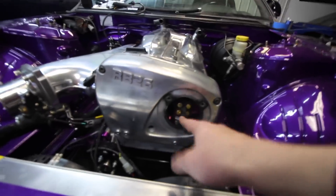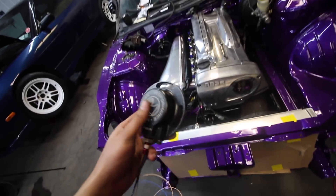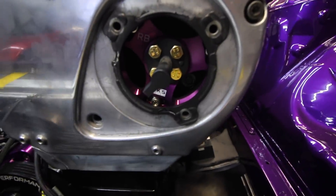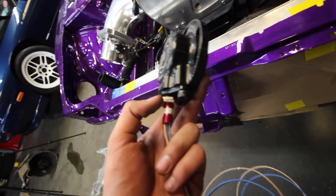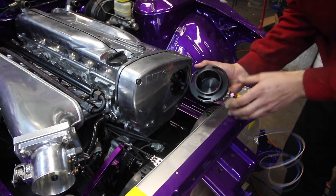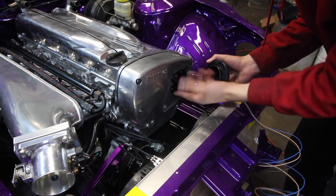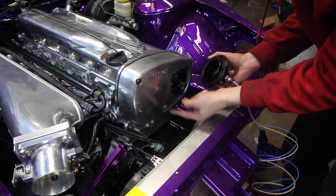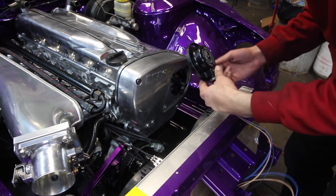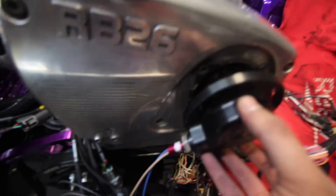I'm basically working on this right now — a very expensive piece of kit: the Ross Performance cam angle sensor. We have a little Hall effect sensor, and it works off that little trigger wheel right there. I think I have it done correctly but I'll send some pictures to verify. Basically, this trigger wheel shows the cam's position, and you want to make sure you have about two to four millimeters clearance between the sensor and the wheel so it doesn't make contact.